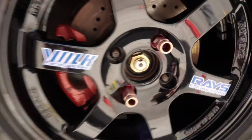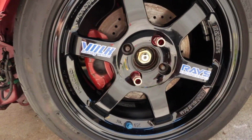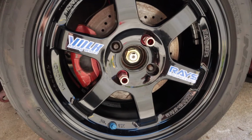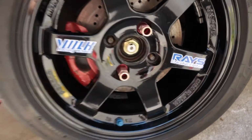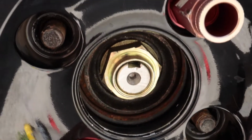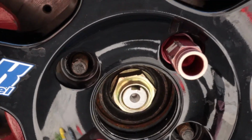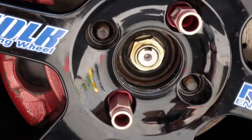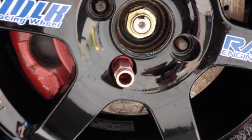All right, so I did forget one thing, you guys, and that's the axle nut, real quick. This bad boy right here. So you want to torque it down. From what I've read, it's like 134 pounds. I did 140, but I'm also going to do it by hand, just real quick, just in case. And then that little spot right there, that indentation, you would want to hit it with a little flathead and just bend it in there, crease it, and that'll pretty much be done with the axle nut. That'll do the job for it. Make sure it's safe and sound. That's it, my dudes.